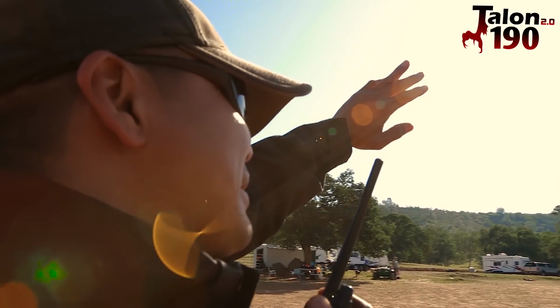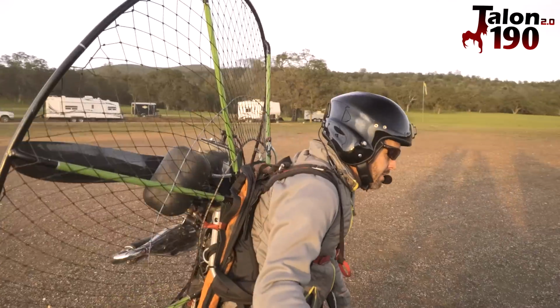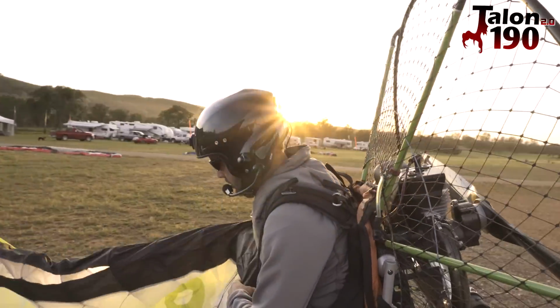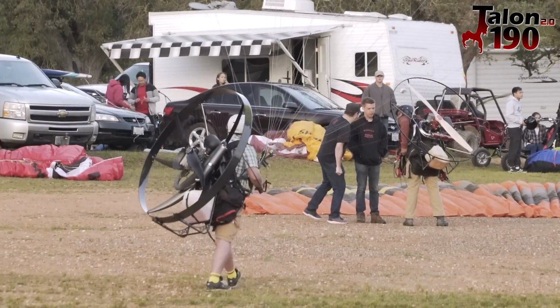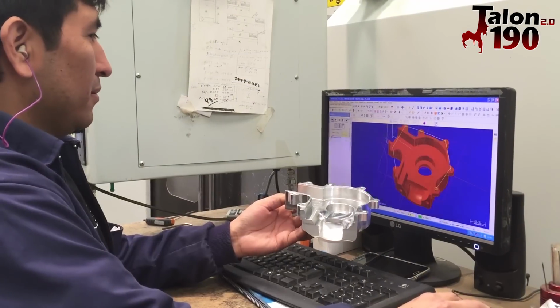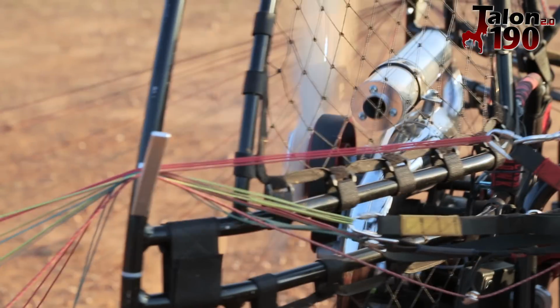No longer is there an issue with the spring breaking and going into your propeller. No longer do you have to use safety wire. No longer do you need to fill the spring with silicone. An exhaust is not an exhaust is not an exhaust. A 2-stroke tune pipe and the cylinder head porting are 2 of the most important things in developing a 2-stroke that makes evenly distributed power, and we're back to that old D word, durability.